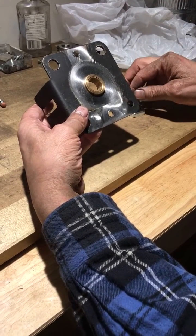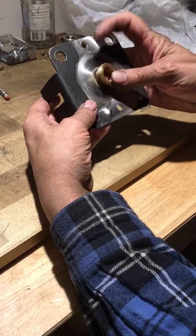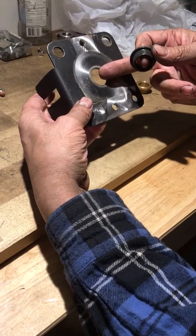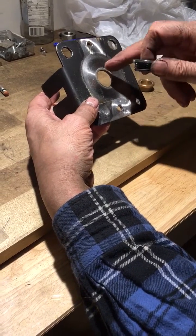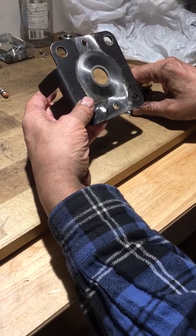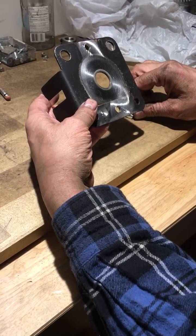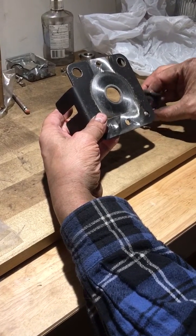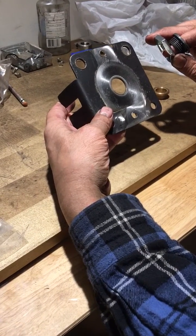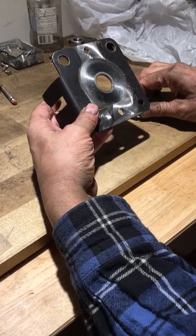The Nylatron bearing has the same inside diameter of three-quarter inches, however the outside diameter is a little bit bigger. To get this in, you can just take one of those titanium step drill bits, drill it out a little bit, and you can pop this right in. The auger will work smoother and the motors will last longer. I prefer the high-quality Gleason Avery auger motor with the ball bearing. This is a real key to a nice smooth auger and pellet flow. This is Don, Pellet Stove Master — thank you for watching, have a good night.